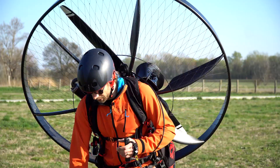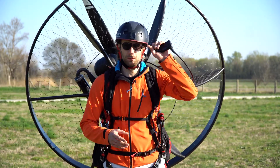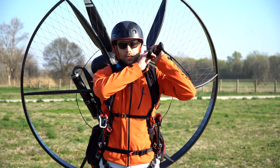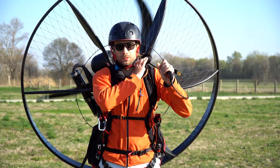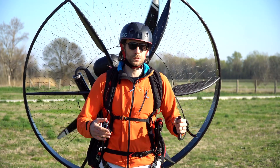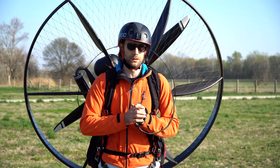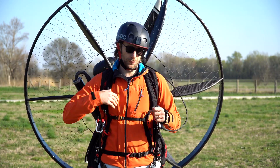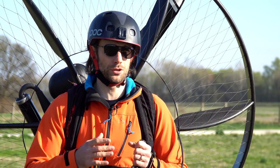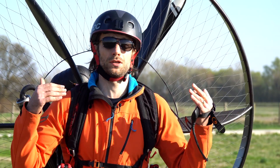I can show you a demonstration. Please don't do that at home, but I will squeeze the throttle to full throttle and just start the engine — look what happens. I started the engine with the full throttle. Without the Safestar, the engine would immediately rev up to full RPM, which would cause me to fall over. But the Safestar killed the engine at 3200, which is around the threshold where the engine actually starts pushing.